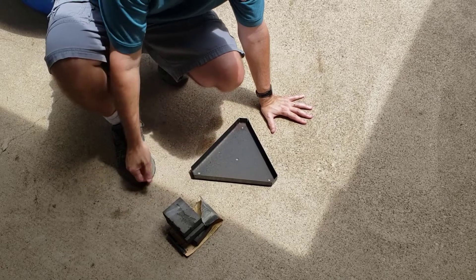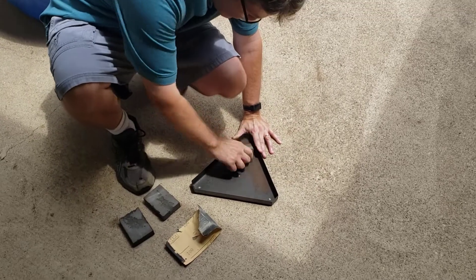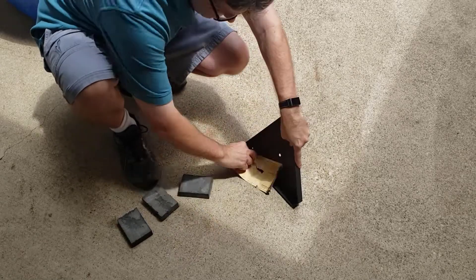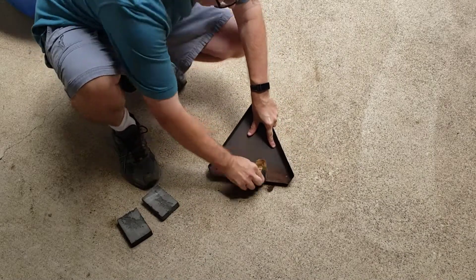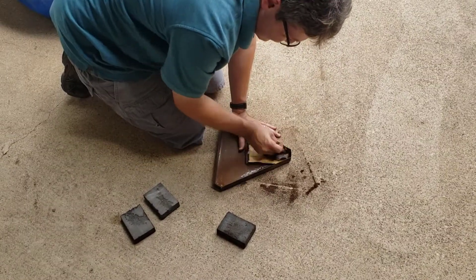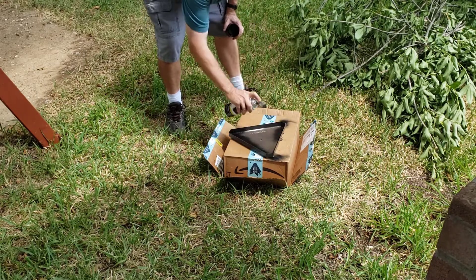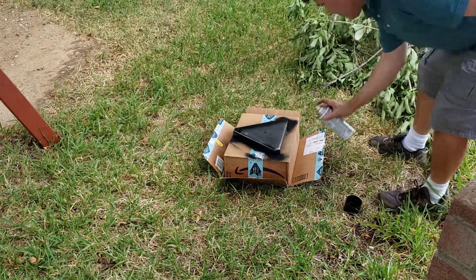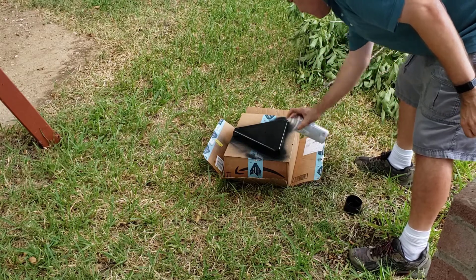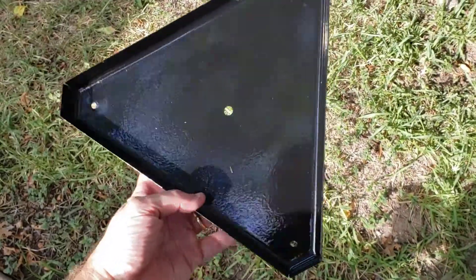The camera overheated so I moved it into the shade. Unfortunately there is some surface rust that we have to sand. My ultimate goal is to get rid of almost all the rust I can find, which means on a lot of these parts it's going to be taking it down to bare metal. When we're all done with that, I'll be painting it with an enamel — actually an enamel with a primer built in. This turned out really nice — looks brand new.